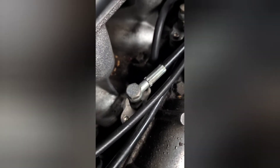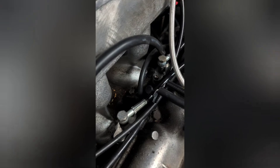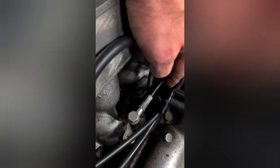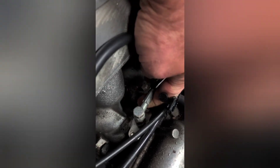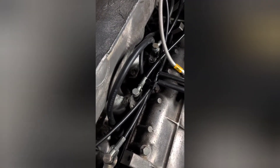There's no way this will come out or lift at all. You can still swivel it just like a normal injector, but it is sealed by multiple o-rings and cannot be pulled up or out. And that's DPI's injector seals.